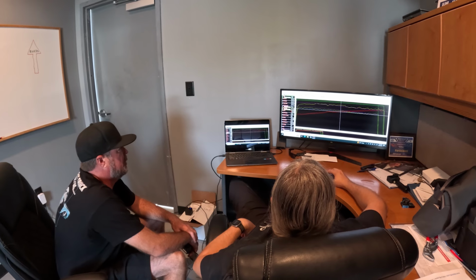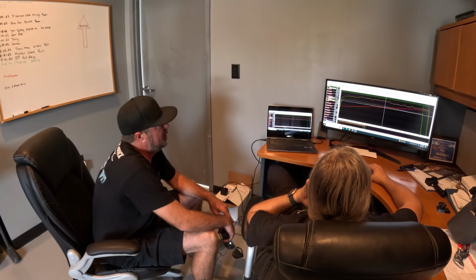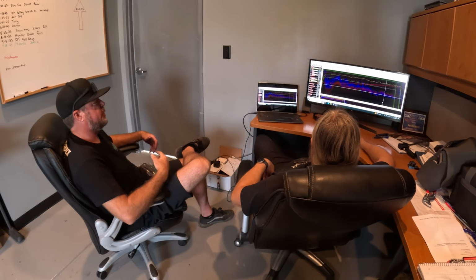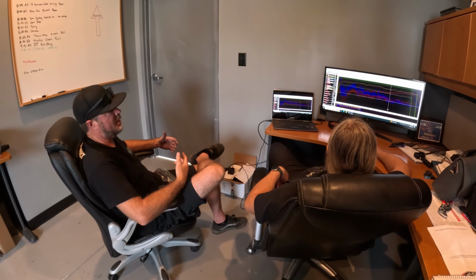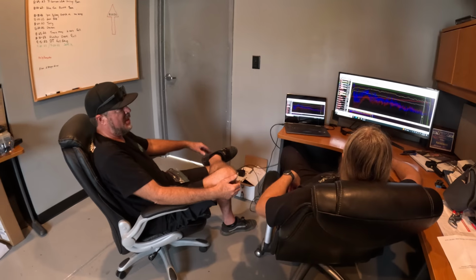And we still haven't explored, are the big headers even doing anything? Yeah, that would be my next curiosity, just to see what that does. We could put those on. The great thing about all this data is I now have so many questions that with enough time you could answer. Like we're targeting 6.5 to 1 air fuel on ethanol based fuel. Is that max power for this motor?